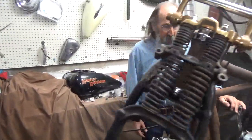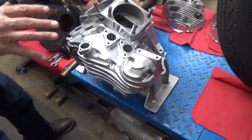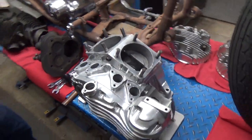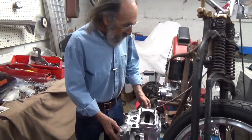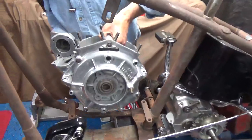I thought I can't wait any longer, and I've had enough requests for it, so let's put the motor in. Now, the thing with this motor — or engine, which is actually correct — is that for me the easiest way to put it in place is with the top end off of it. There's nothing in it now. This is just strictly for mock-up purposes. I'm going to set the engine in place. I'm not going to shim it, which I will in the final build, but not just for putting it on.